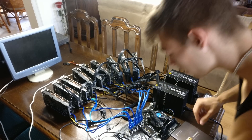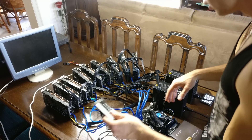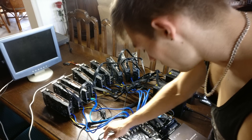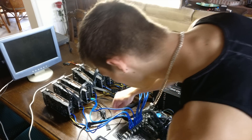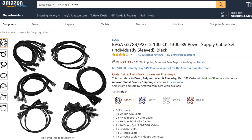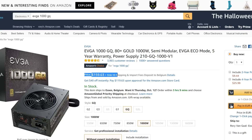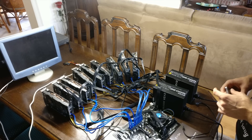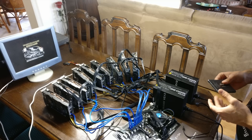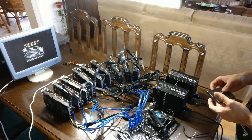We're also using two 1000W power supplies. We had one laying around — it's the one with the burned down SATA cable, so we didn't have SATA cables anymore for that power supply. It was kind of useless to use in another build, and buying $80 cables for a $150 power supply didn't make sense when we could just buy another power supply for almost the same price. This gave the miner a really good efficiency boost — we're using 2000 watts of power supplies but it was only using about 680 watts.